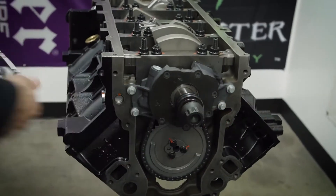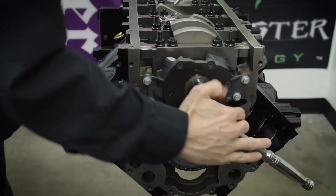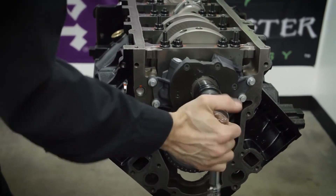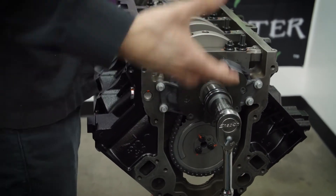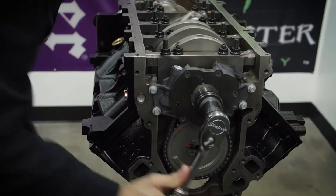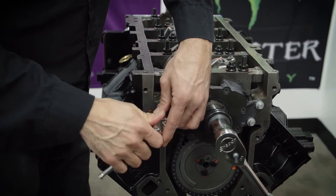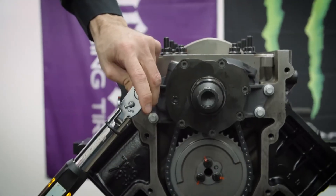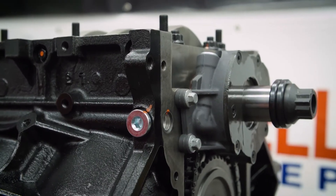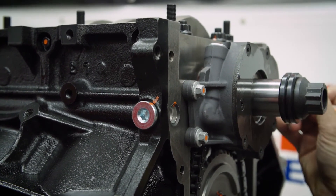To do that, we just want to rotate the motor a little bit. And now with the snug bolts, once it finds its kind of home, it'll stay in place and it'll actually center itself. Then you just torque it down — I'm just going to gradually bring them in a little more. These get torqued to 18 foot-pounds. Because we like to double-check our work, we're just going to put a little dot here to let us know that these are torqued to spec.